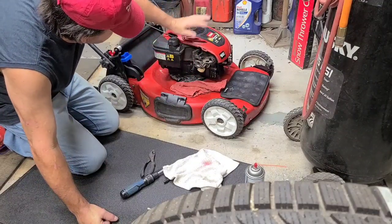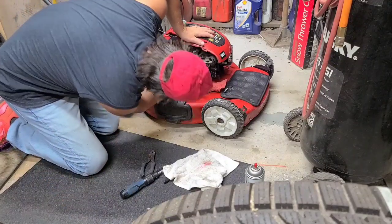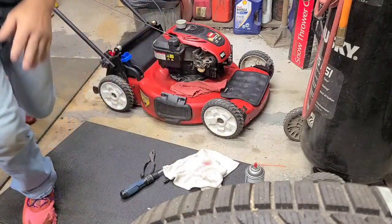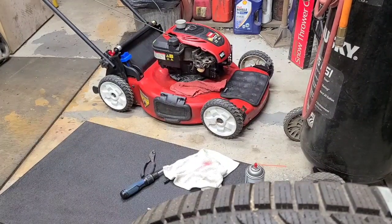What about this system right here? I think I'm going to have to unhook it because it needs to stay behind. Let me find a piece of hose. I'm gonna check the float. If the float's good, I might just try sending it. Hang on. Alright, looks like we're pulling the carburetor. Put some of the stuff behind you. I don't like how that float is working. I have a feeling that that white powder is inside the needle seat and it's not shutting off.